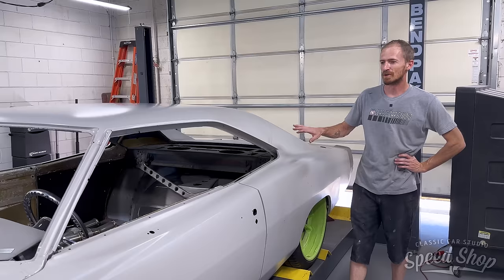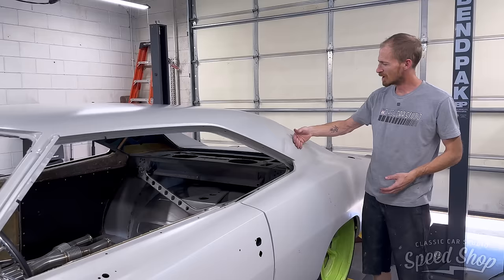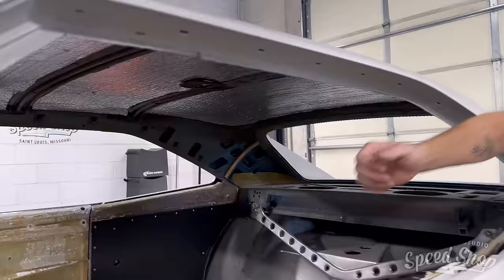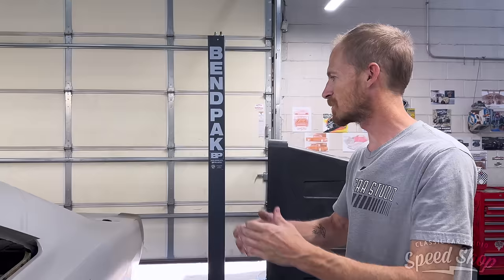We are going to be making a one-piece fiberglass headliner support structure, and we're going to be making that by using the exterior roof. So I'm going to go ahead and tape over the quarter seam here and make a dam here, and we're just going to use the roof as a mold. I will lay the fiberglass over the entire roof, pop it off. We'll probably have to section it and narrow it a little bit, but then put it back together. But we'll be able to size a headliner with a perfect crown of the roof and just move it to the inside. So we'll have that all in one piece of fiberglass before too long. Like I said, I'll get started on taping out my form and we'll get going.